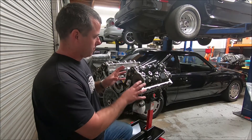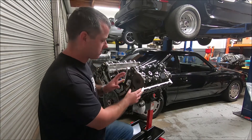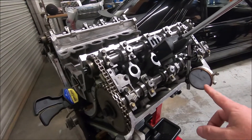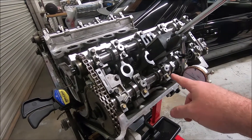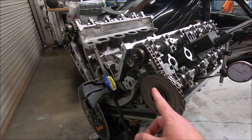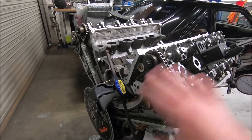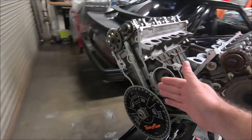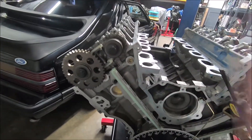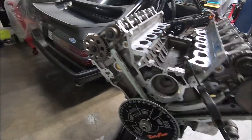So think of it this way: do you need the camshaft to be more forward, or more advanced? That's what we're going to do when we grind. On the engine here, I have the dial indicator set up on number six. I start with number six because once you get this side done, you pull the pins, put the tensioner back on, and this side is done. You move over to the other side. This chain on this side sits in front of that one, so once you're done with this one, you can put all your covers on.